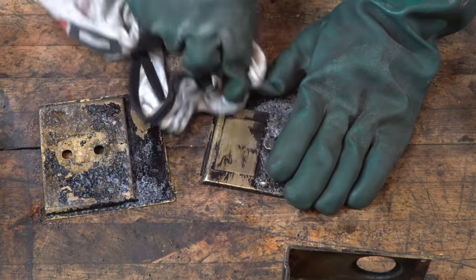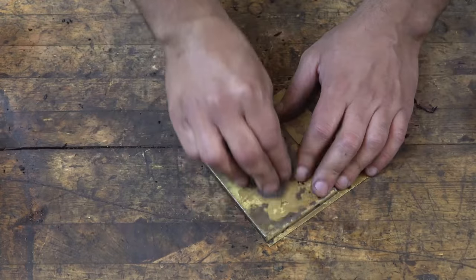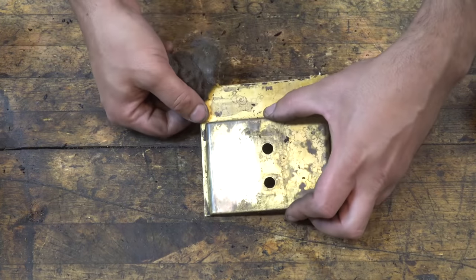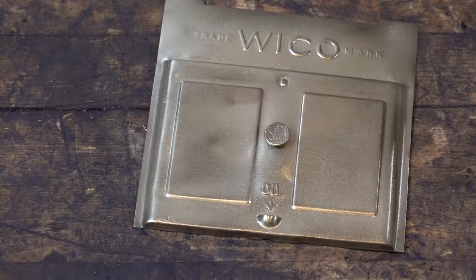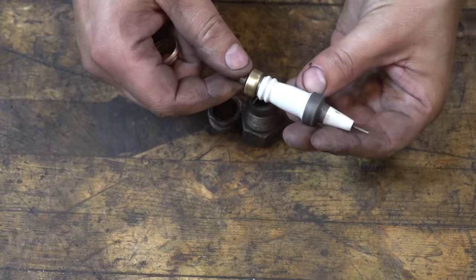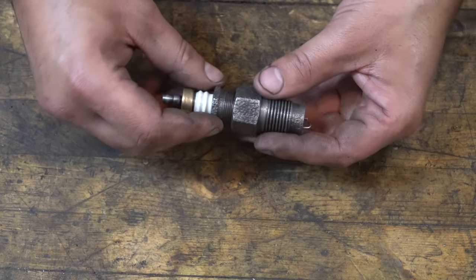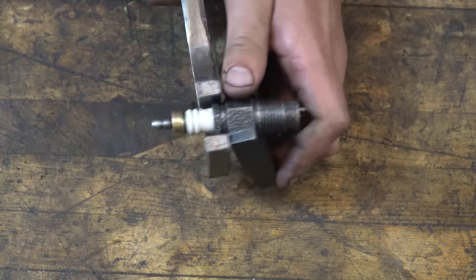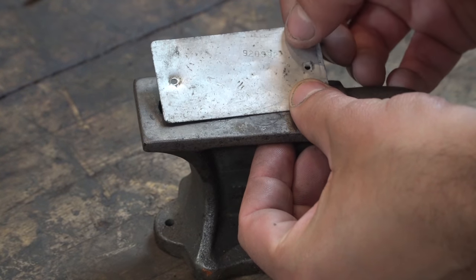We need to remove this blasphemous black paint over brass — it's not original and it comes off incredibly easily, which is another sign it was not original. I'm going to take a long time here to hand buff with steel wool the outside of all of these, then give a little accent of red on the stop button — and I'll wipe the paint off to reveal the lettering underneath. The spark plug you can actually service and take apart, so I've done that. I should have replaced the copper washer but that's not the end of the world. Just tighten it — not so tight that you crack the porcelain top — re-gap it and it should be back in service.